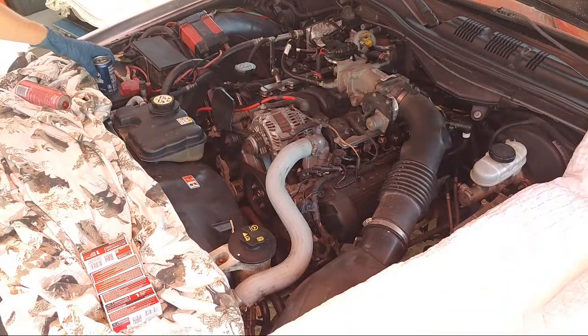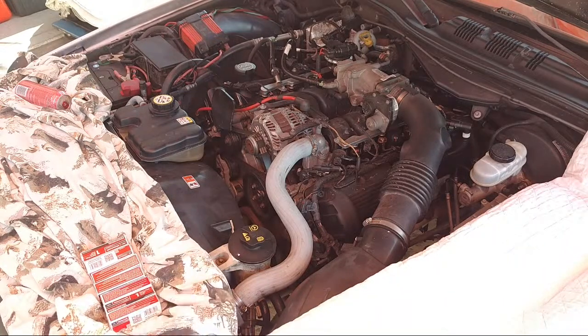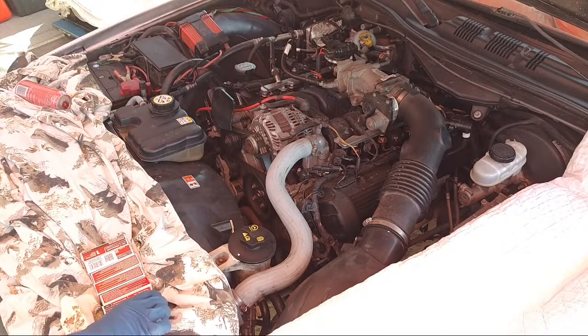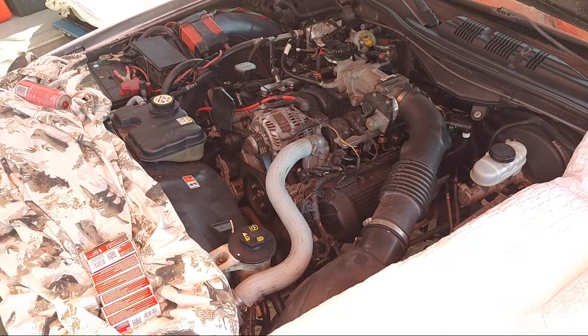I just went through a massive overheat, like 2 weeks. I had to do a bunch of work on it, so I mostly solved that problem. I'm good to go, but I had to basically replace almost everything. My radiator clogged, had to replace that. I replaced everything: water pump, both sensors, thermostat, so the entire system got replaced. But it's still having some issue. It might be some clogging in the block, but we'll talk about that later. But for now, doing some plugs.